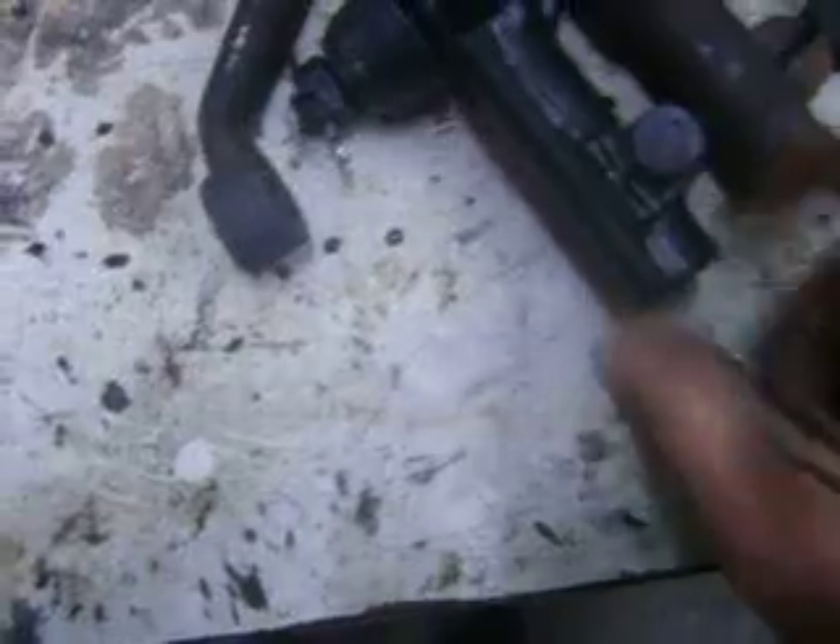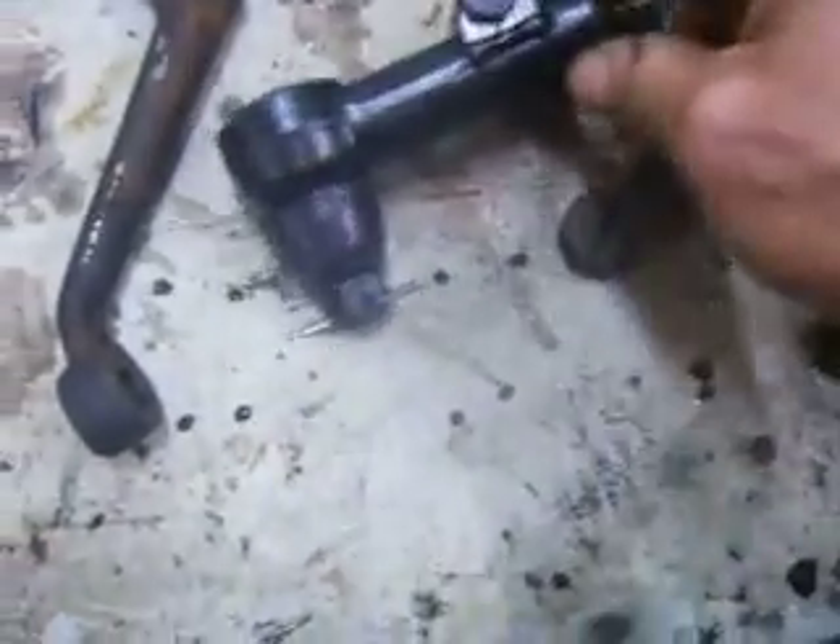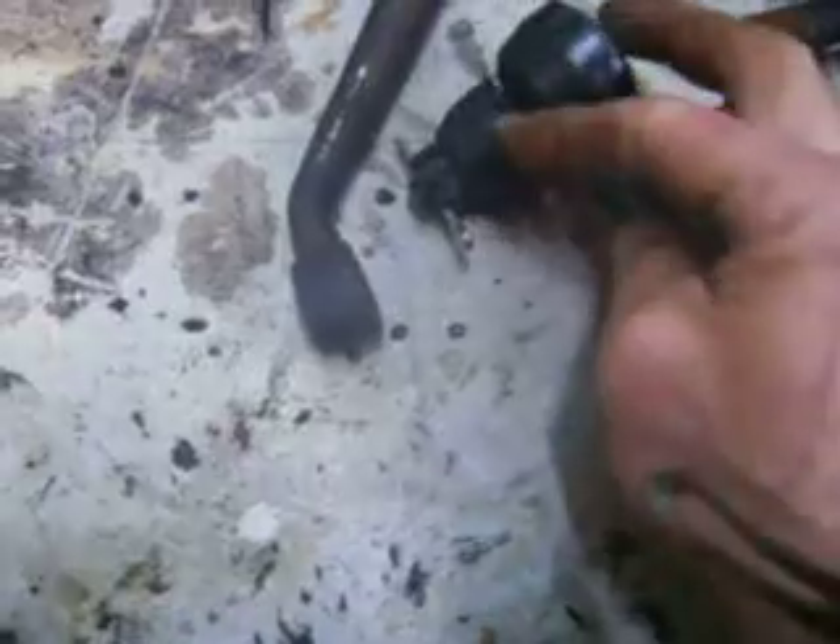You get rid of all that and put your steering arms on. We have these brand new tie rod ends — this end is just like the other one. There's a collar that goes around this to tighten down on the tie rod once you get it on there and get it all adjusted, get your toe-in adjusted and everything. That replaces that old ball and cup system. These are not a tapered bolt because this hole is not tapered, so these are specially made to replace those. That goes through there and then you put your castle nut on and your cotter key in.